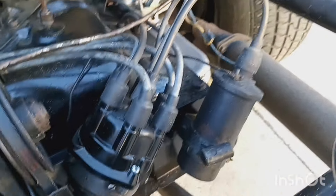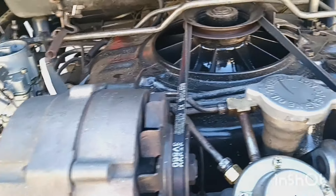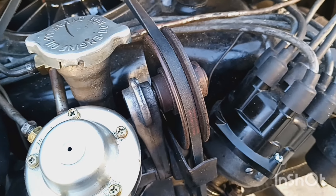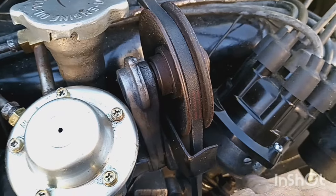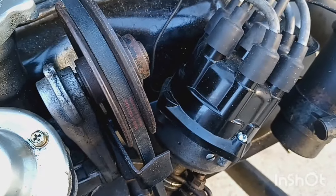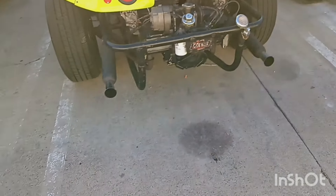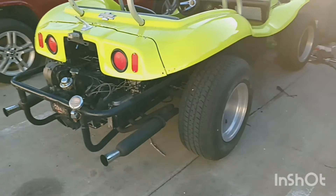We also don't know the condition of the points. My point is, if we really wanted to make this thing run perfect, I'd have to go through step by step — make sure the carburetors are done correctly, check what fuel jets he put in, restore the vacuum advance system, put choke pull-offs on both sides, probably do an electronic ignition. It's running good now and has more power than it really should — the thing will almost pop a wheelie if you're not careful.